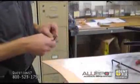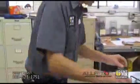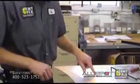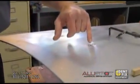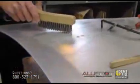The nail released prematurely, which is no big deal, because you can just reattach another one — but the dent is almost out at the same time. It'll pull up this area here, and we'll probably still have a low spot in the middle, so I'm just going to clean it up and put one more nail in the middle and do a single pull.